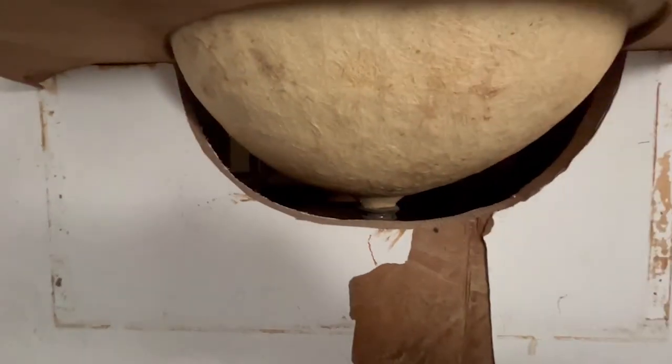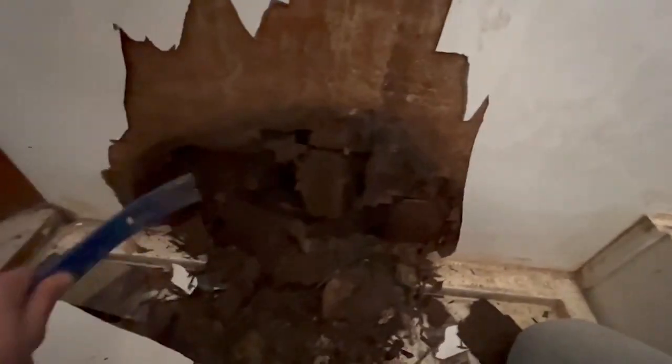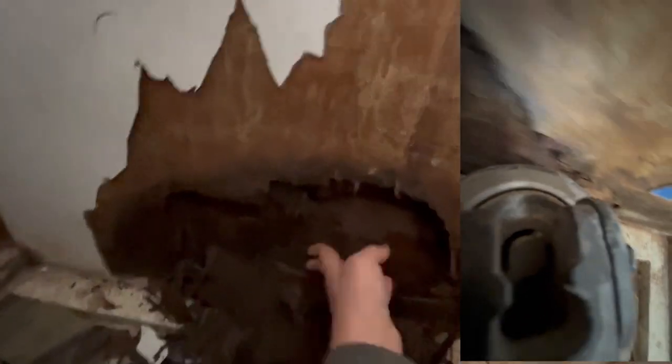So we've uncovered it. Unclear if it's a sink drain leak or if it is infiltration from the shower. But what is clear is that it's turned to dust. It feels like there's some fiberglass back there though, which is good. Chances are, I can go ahead and take a small section out and glass in a new piece to at least connect it back to the back wall. Then I'm thinking replacing this shower wall that is all busted up.